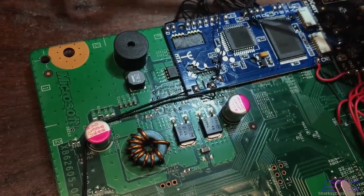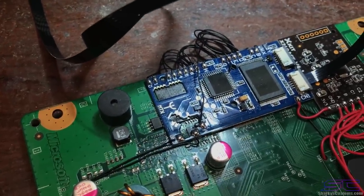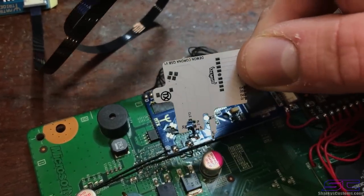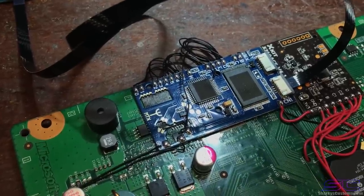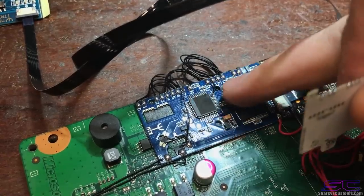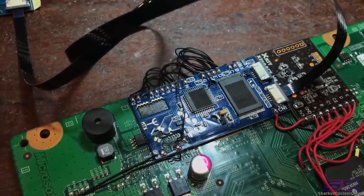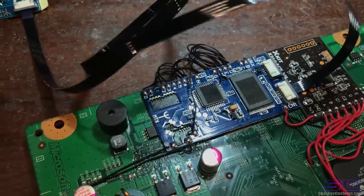They were telling you to remove those two - the G wire right here and the CE wire. I have a diagram that I made for you guys. I used this, which is a conversion for the Demon Dual NAND for a Trinity version, which would convert it into a Corona so you could put this on a Corona board. But that didn't work for this console because it's a 4 gigabyte and that's for a V1. So I converted it - I figured out the pinouts and labeled them because the original letters don't make any sense. You can download the diagram in the description. For me, I had to put the CE and the WP - which is the G wire - back on for this console to work properly.